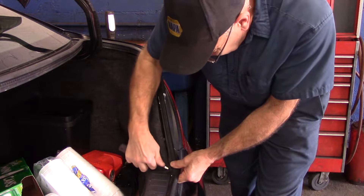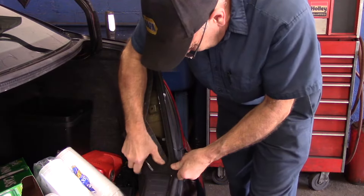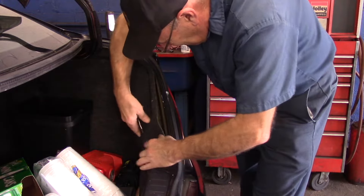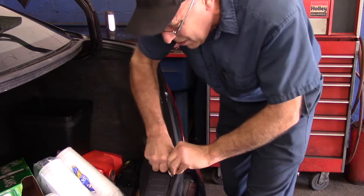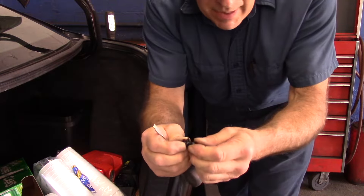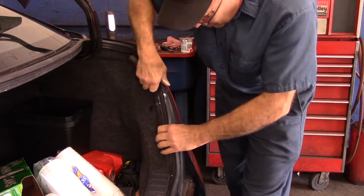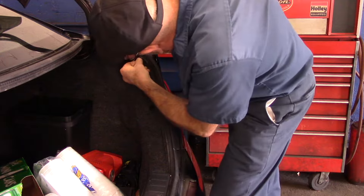First we line up this piece over here, then coincide it with the vehicle and get the other pieces through. They're both through — push it and you feel the snap in. Then we come back over here and screw on the 10 millimeters we previously took off. Again, just snug — the other end is in the plastic light itself. Take our cover, put it back where it belongs, put it under the rubber here, push it back in. Take our push pin, keep the pole out, push this in, then push that piece back in.